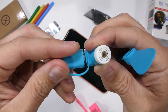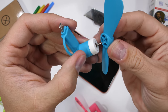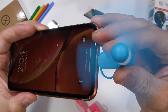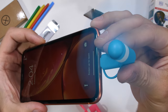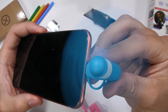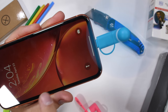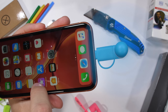Let's start with this fan thing. It's got a micro USB main port with an iPhone lightning port adapter. The fan has soft rubber propellers that are friction fit to the shaft of an electric motor. You might be thinking, wow, that's pretty cool — iPhones might actually be good for something. But here's the problem: iPhones are not designed to throw this kind of power out of the phone. Some Android phones can, but by powering third-party accessories with a lightning port, there's a high risk of frying the internal charging port circuit, causing it to burn out and stop charging altogether, basically ruining your phone.